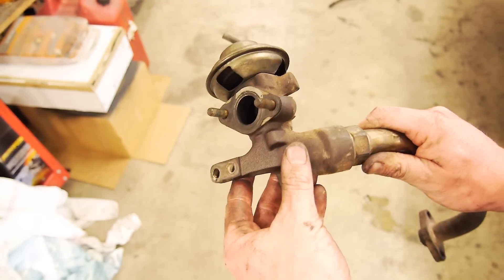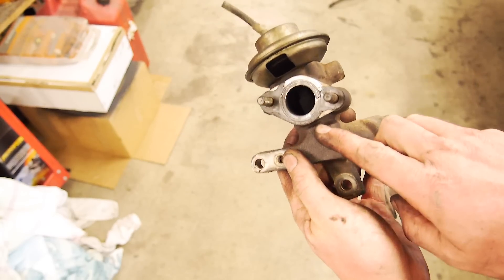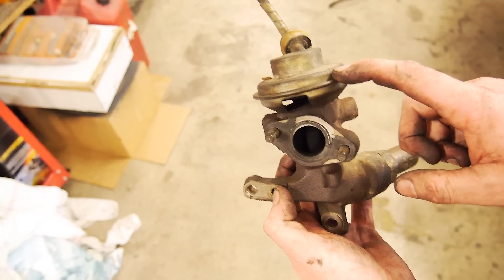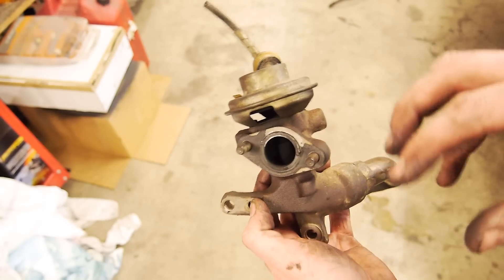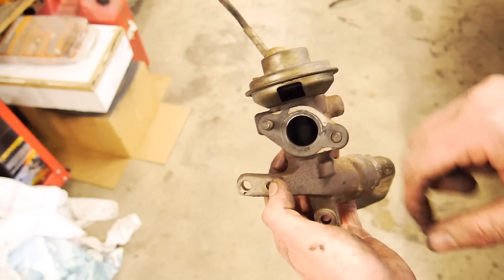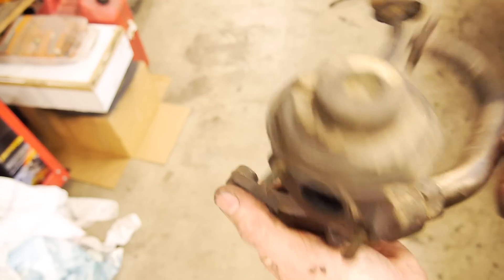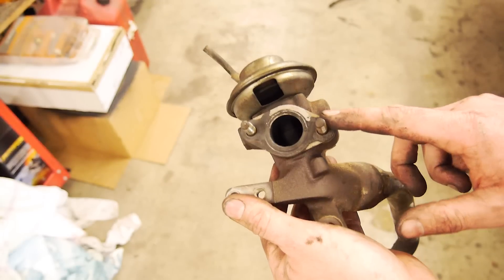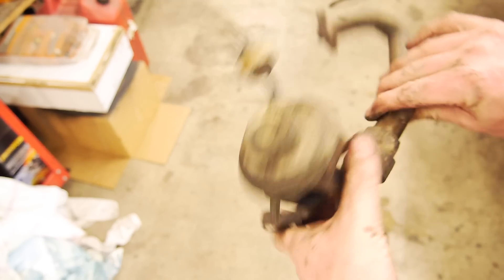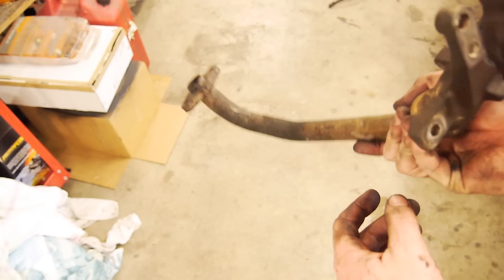So here you have it — it's basically like an external wastegate. Exhaust from the manifold comes through here to the underside of the plunger, and when it gets a certain vacuum — I think it's around mid-throttle, not at idle, not at full throttle, just cruising — this valve opens up and directs exhaust gas into the intake. Really stupid system honestly. These cause a lot of carbon buildup and ultimately engine failures if it's not caught, especially on a lot of the newer diesel cars like the D4Ds and direct injection diesels. So it can go in the bin.